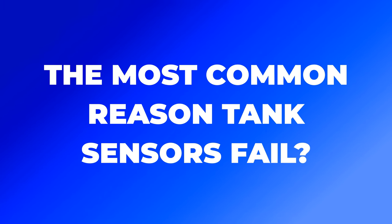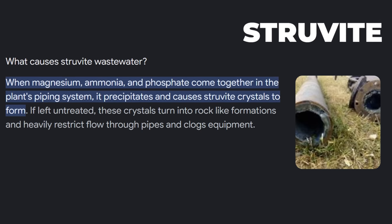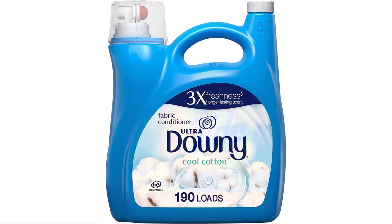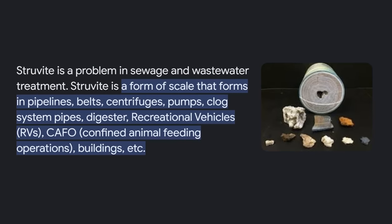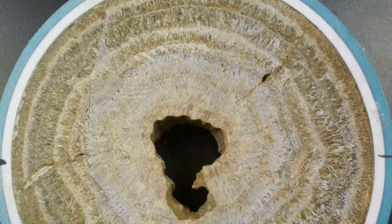So there's no peanut buttery sludge in your tank — what is actually causing your tank sensors to fail? It's something called struvite. It comes from a natural process when ammonia, phosphate, and magnesium combine, they precipitate and form crystals. All of these ingredients are found in urine. A lot of people have asked about using laundry detergent or fabric softener to coat the inside of the tank so nothing sticks. I've heard people have success with those products, but at the end of the day struvite is a very common problem in wastewater infrastructure — it was discovered long before RVs were even invented. It forms like a crystal, and if the environment doesn't change it will continue building on top of itself, sticking to everything inside the tank no matter what you coat it with. The tank sensor issue is probably because of struvite, not because you're using a black tank treatment that liquefies waste.